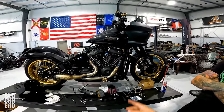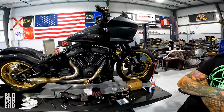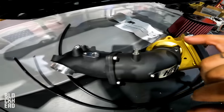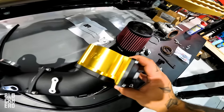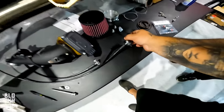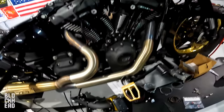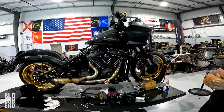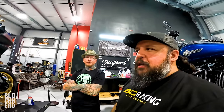I've heard mixed things about running without balancers, but I've ridden a couple without them and they were just fun. The point of this bike is to try things and see what breaks. We're throwing more and more power at it to see what breaks naturally first. What we're throwing on now should give it more power. We've got the HPI manifold — the tunnel ram — a new throttle body in gold, an air cleaner coupler, and we're going up from 5.5-gram injectors to 7.1-gram injectors, still externally vented. We've got the bracketry and lines from Horsepower Inc., modify the tune a little, and it should be ready for the weekend.